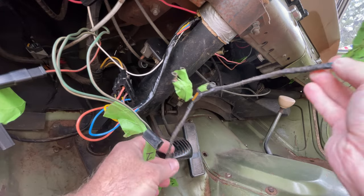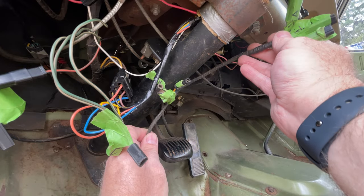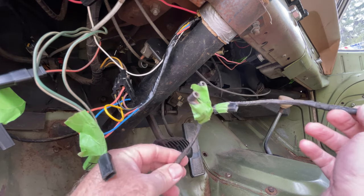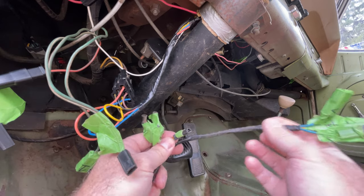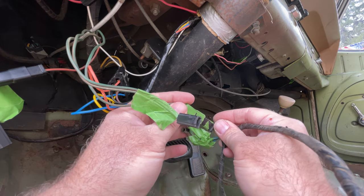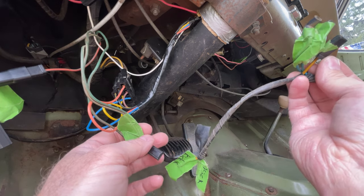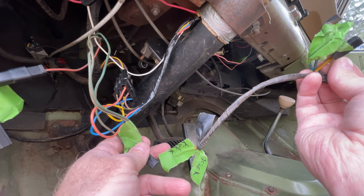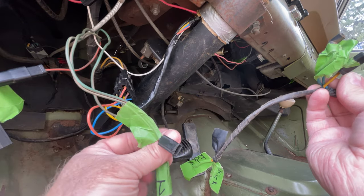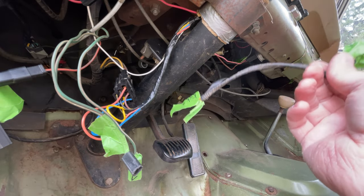The kickdown wire - I believe that sends power down to this one. If you look at the way the harness and the memory on how the wires want to lay, these wires want to sit up in there and they're just long enough to reach back over to the kickdown switch. This is the other side of the kickdown, so this is the kickdown wire that goes out under the hood and plugs into here. That gives power to the kickdown via this wire coming from the ignition switch - when the switch closes, meaning you've floored it, it sends power through to this wire which goes up through the hood and back down to the transmission solenoid that we tested a few weeks ago.